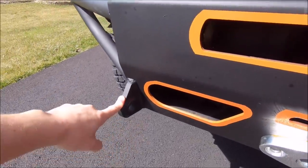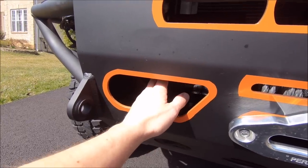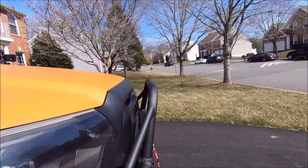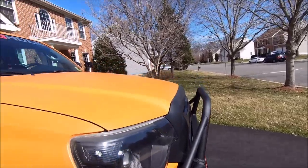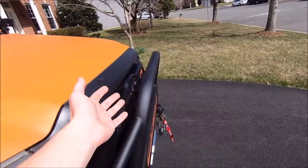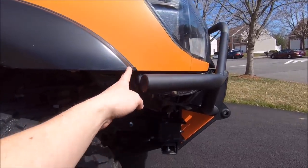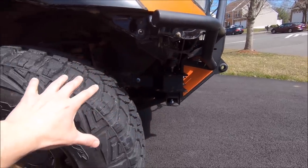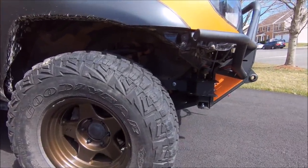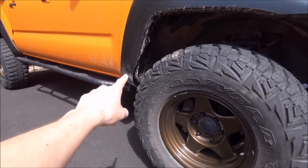You do have two solid recovery points up front. Currently I have my winch hook on one side. You have two access points here to easily access your winch. As far as dimensions, the front hoop is just about even with my hood line, and when I'm sitting inside driving I can see the top of it just a little bit — sticks up maybe an inch, inch and a half — which is perfect for using as a feeler in tight spots on the trail. For the side pieces, you can see it ends almost dead even with the top of the fender trim. I have a lot of clearance from my front tire, which I've had plenty of rubbing issues with at three and a half backspacing. I'll probably get a realignment to adjust the caster, slide the tire forward maybe half an inch to get more clearance when it's fully stuffed.